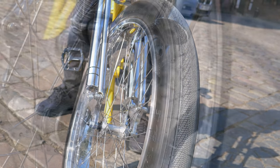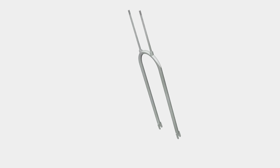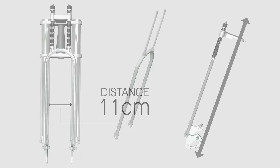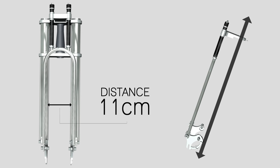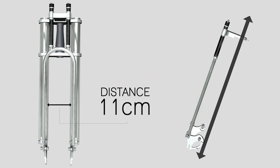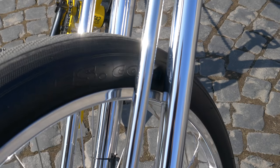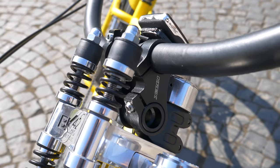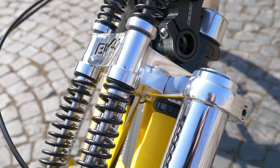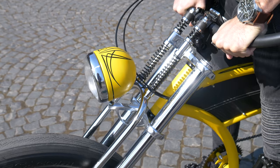After a few attempts I finally found all the necessary measurements. I finalized all parts using 3D software and sent them to the CNC cutting company. The front arch and the spring guides are made of stainless steel. The distance between each leg is calculated according to the ring size and is parallel to the original fork. For the chrome appearance, all parts are made of stainless steel and very well polished.